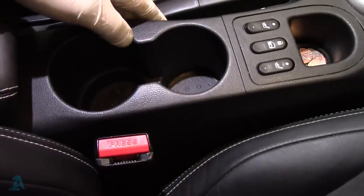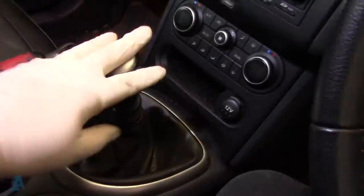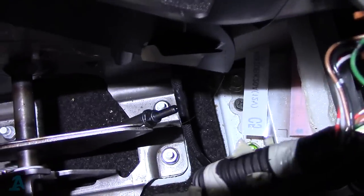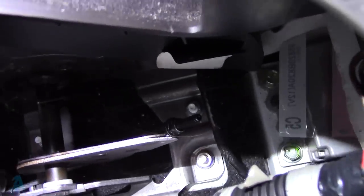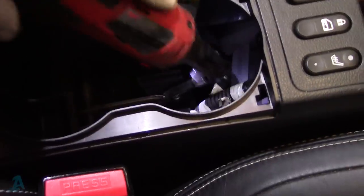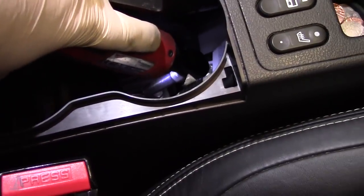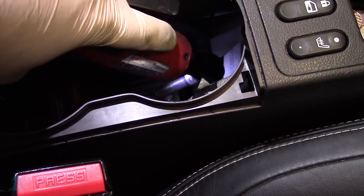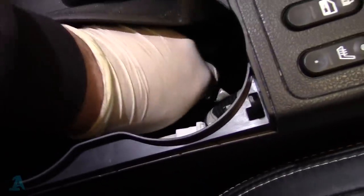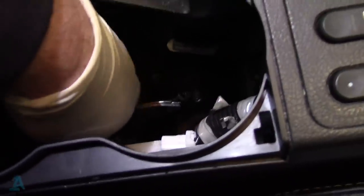First of all, we'll take off the adjustment on the cable. This is under the cup holder, so you've got your gear stick there, and the cup holder — just get a little bit and give it a bit of a tug. So inside there's a 10mm nut, that's on the first cable. And then down there at the back is where the cables join into that splitter. You can see it's on an angle — that's obviously because the one cable's not doing anything. I've got the socket on. Just loosen that off. Plenty of slack there now.